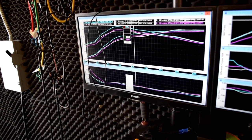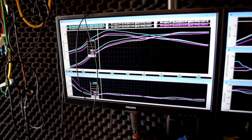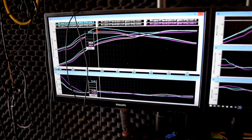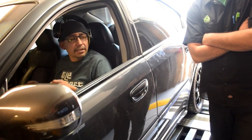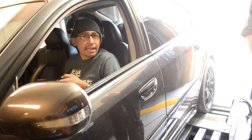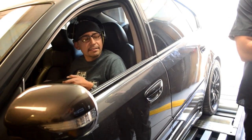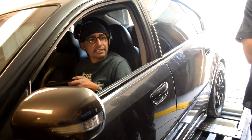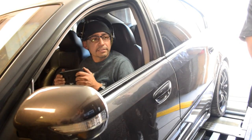What did you do on that last pull? I raised boost — I went from about 19 pounds to 20. 18.7 to 20, and we picked up quite a bit of torque there. 340 torque up from about 325 — for one pound of boost, not bad at all. I think if I had head studs I could check what it would do with more boost, but I don't want to go to 22. This is a great place to stop where we leave a huge buffer of safety, and I think that's the most important thing.